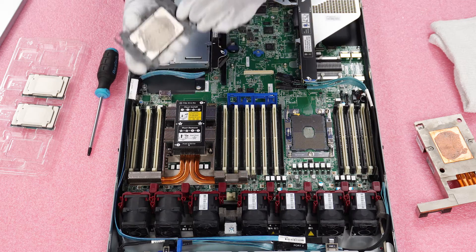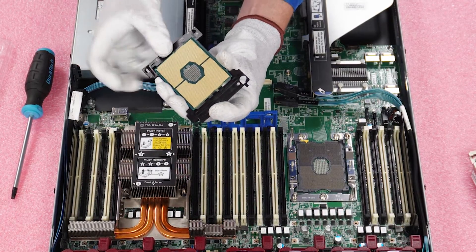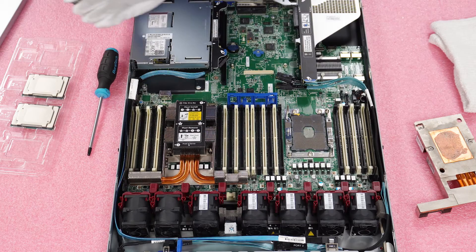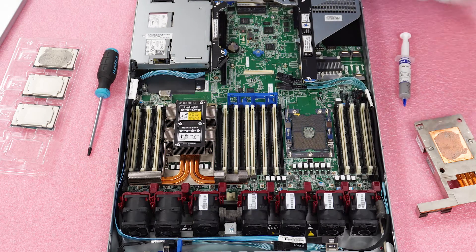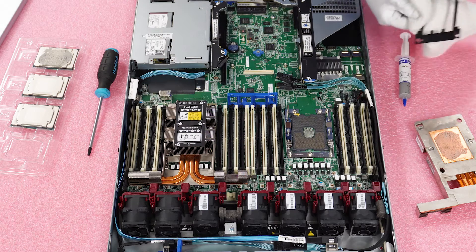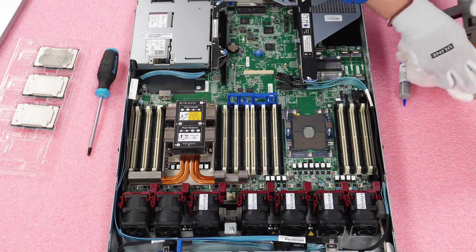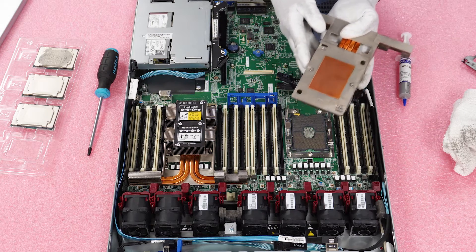Now the CPU is just with the clip and everything is exposed — so let's be careful. Flip this over so no thermal paste falls in. You'll see the black clips — when you pull these back you can remove the CPU. The plastic is somewhat flexible so it has a little give; pull it back, unhook one side, then pull the other side out. Set the clip aside and set the CPU down. Next, we want to clean everything up — not over the exposed pins, so we'll do it off to the side. We also want to wipe the old thermal paste off the heat sink.